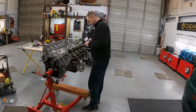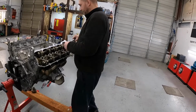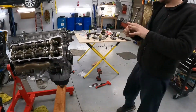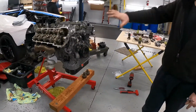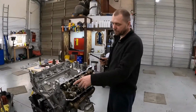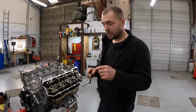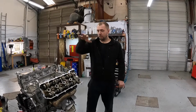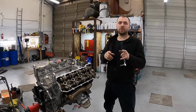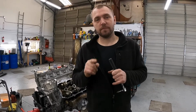It's coming along. I'm just doing some final touch-ups before we put the valve covers on. See guys, almost ready, the front crankcase. Now it's time for timing the camshaft bearing cap, 10 newton meters torque. Now we retorque the left side and right side, and then we start to install timing. I will show you how to install and set up timing, and how to do it properly.